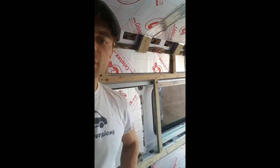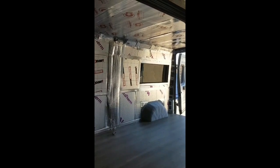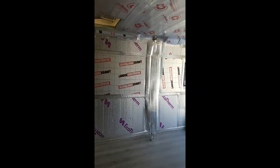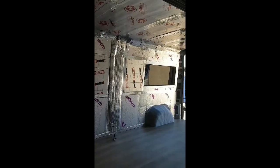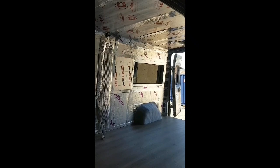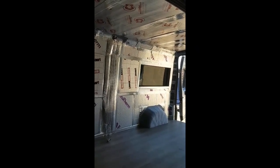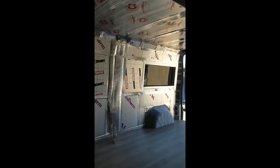I've added a bit of extra battening to create the window seal. I've just finished insulating the driver's side wall — I've used the battens to friction fit 25mm Celotex. This creates a vapour barrier similar to the ceiling, and it's a really neat way of using efficient insulation and having the right materials there for your fixings when you're going to panel and clad the walls.